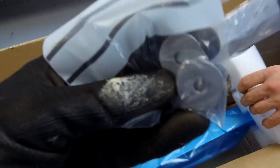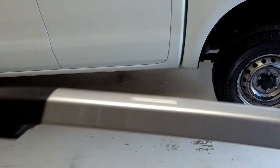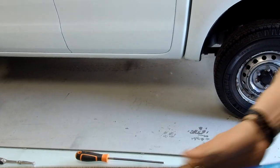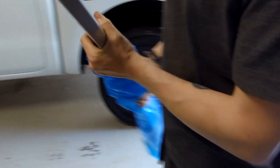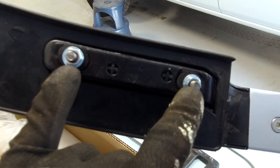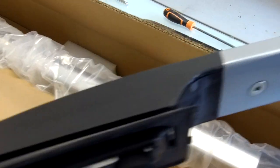We've got some washers — they go under the inside pack. It's aluminium. You can tell by the flaps at the front. Obviously the roof bar slopes outwards. That's the one we've already fitted; this is the one we want. We've got a little tab — dog flap, whatever you want to call it — going to the front. And we've got some M6 fixing bolts, so we'll need to drill two holes at the front for those.